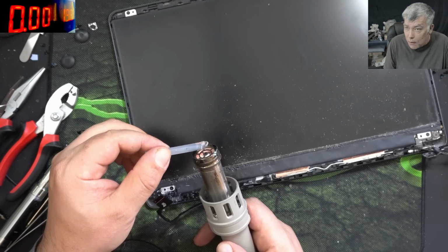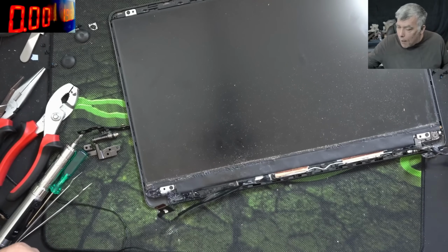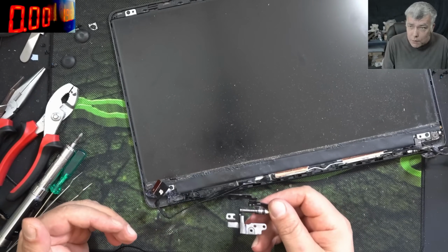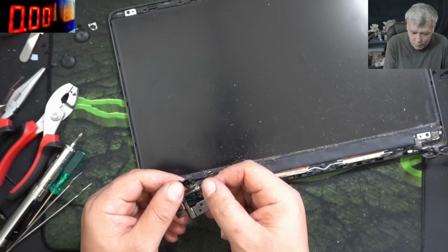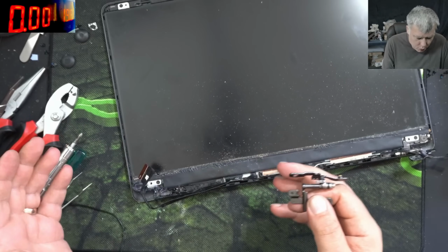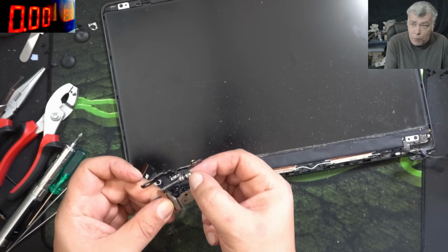I've seen everyone has a concern about how strong the hot glue is. Not sure if you realize, I can stick the hinge back with chewing gum, and it will work fine. So it's not about what you are using, it's about what pressure you have here. Because if you loosen this screw, the screen assembly will still work fine. So this hinge will take the heavy load, and this one will be fine with whatever. Even if you don't want to use hot glue, you want to use something weaker than hot glue, it will still be fine. So it's up to you to adjust the screw properly.